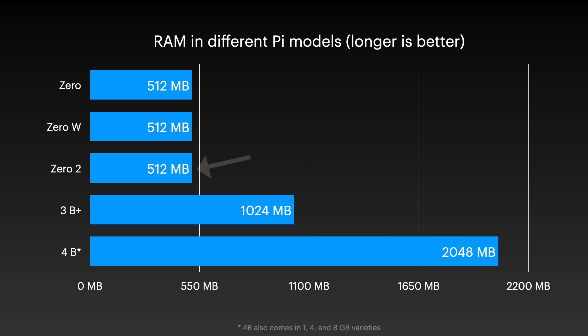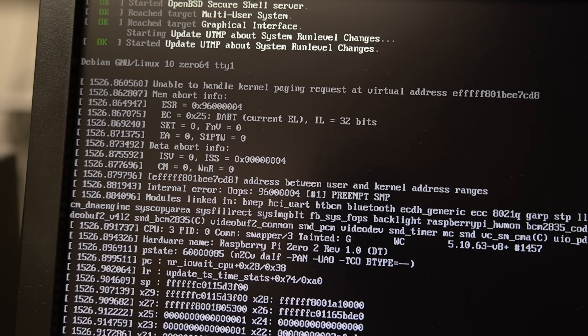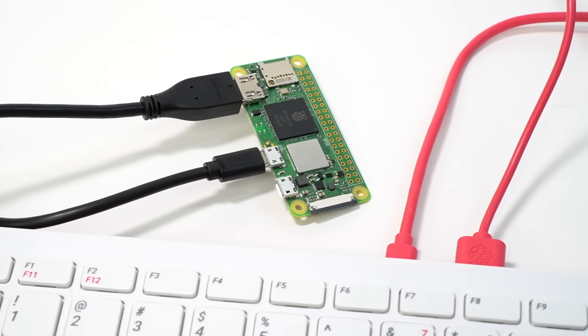I had to do a couple of hacks to get it working pre-launch, but by the time you're watching this video, it might just work out of the box. But there's a bigger problem on this Pi, especially bad on the 64-bit Pi OS: it only has 512MB of RAM. For some benchmarks, I had to add swap space so the out-of-memory killer wouldn't kill processes. Some 64-bit apps showed weird errors even with more swap space, since 64-bit memory addresses are larger and 512MB can be a little tight. So the Pi Zero 2 is not going to be great for things like video compression or using as a desktop computer running Chrome, especially not with 64-bit Pi OS, but that's not what it's meant for. I do wish there were a gig of RAM, but I can't have everything.